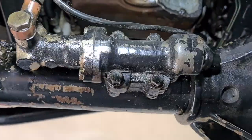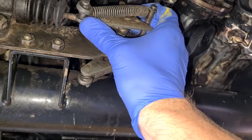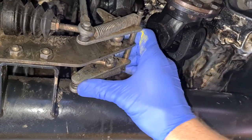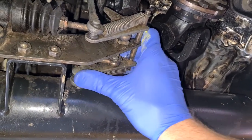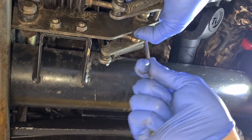A flexible brake line comes down and both the rear brake line and slave cylinder share the same line. Going towards the front of the car you'll see the front slave cylinder, which has a banjo fitting. On the left side of the screen you can see that line is different to the rear. There's the electronic switch. You can see from the bottom: the rear setup will move, but the front one will not — it's jammed.